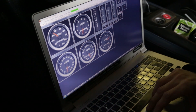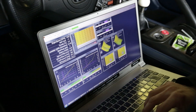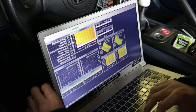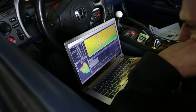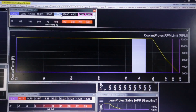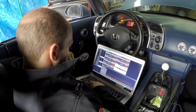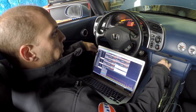As you can see there are all kinds of cool gauges and stuff to play with in the Infinity tuner software. Once Sasha got all the screens configured to his liking and the base map sorted, he set up some of the engine protection features, like limiting engine RPM once coolant temps climb above 212 degrees Fahrenheit. Now it was finally time to do some wide open throttle pulls and see if our F20C picked up some serious power.